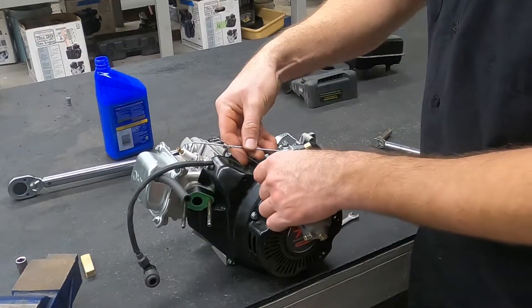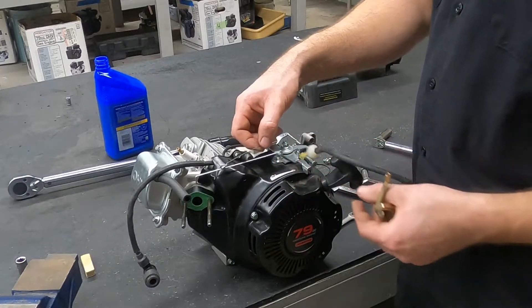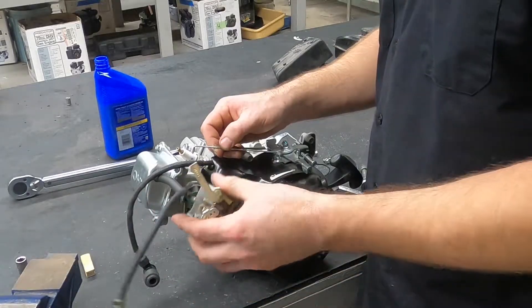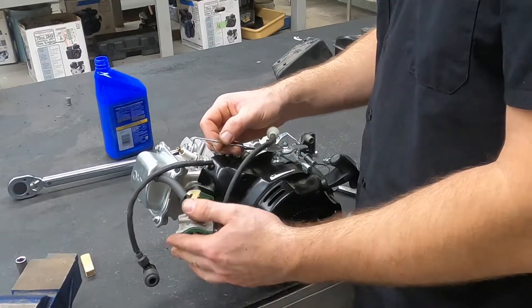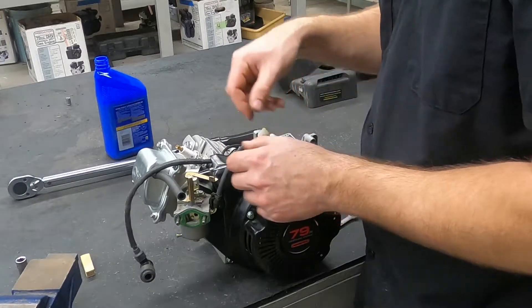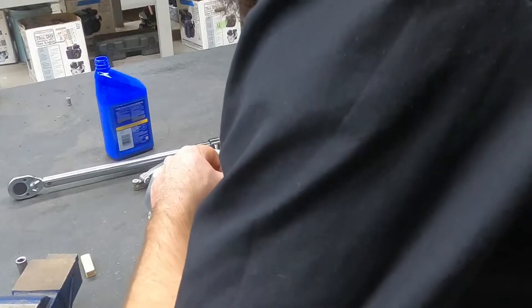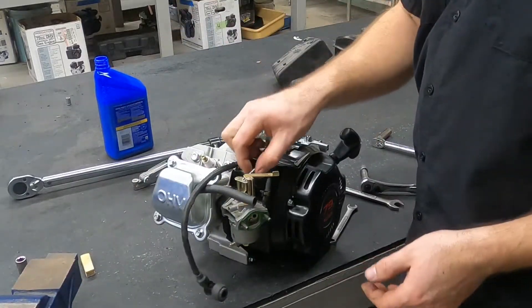This is a little bit of guessing. I don't know which position it's supposed to go into. We'll start out with our throttle arm in the outboard hole of the governor, and then we'll put this into the inboard hole on the carburetor. But we'll put the carburetor on first, actually. The choke arm sits to the outside. Now we'll put this arm into the center part, and use this spring to hold everything down on this end.